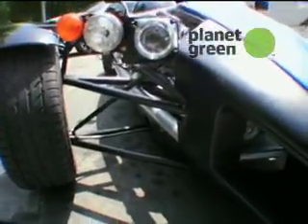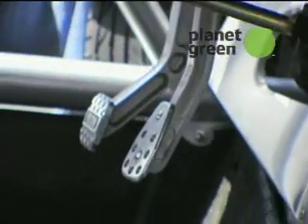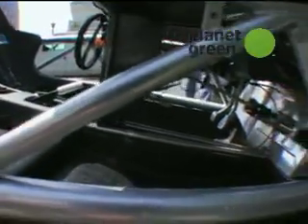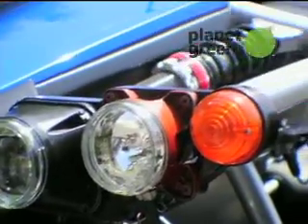The motor is here. The very nice thing about electric motors like this one is that they have an incredibly wide torque curve. In this car, it'll do zero to 105 miles an hour in one gear. So there's no clutch, and you never have to shift. The whole system seems incredibly clean and efficient. Mechanically, it's very, very simple — the motor's got one moving part, there's one gear in the transmission, and that's basically it.